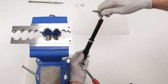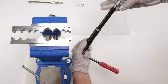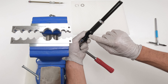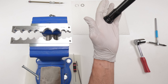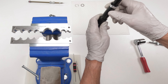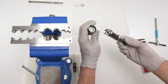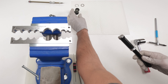See if I can unscrew it from the top and create a little bit of separation between the bladder and the cap in order to pull down the bladder. Now that I know I can separate it by hand, always hold it downwards when separating — never upwards. Why? Because if the cap part separates instead of the bottom, you don't want your shims to fall out. This way if it separates from the bottom, your shims will be intact. And it separated at the bottom — so we're good. Take the whole cap and leave it there.